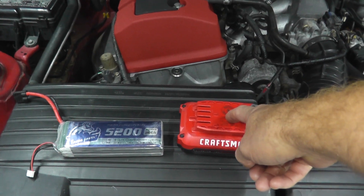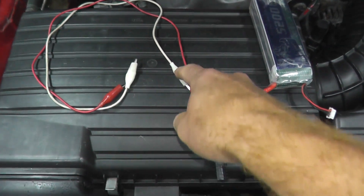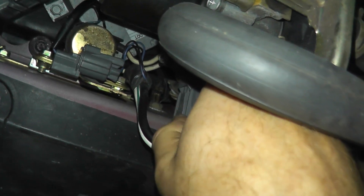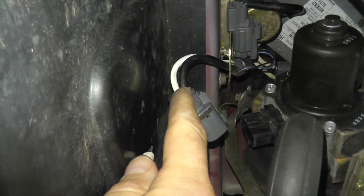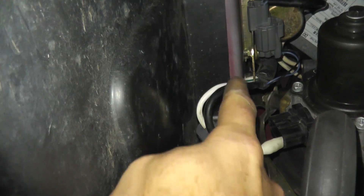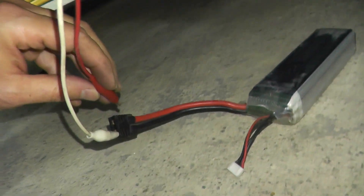You can use a cordless battery pack. In my case I have an RC battery pack that pushes out 11 volts, and then I have two wires with alligator ends. This will allow us to send power from the pack to the pump. We need to find the electrical connector — there's a harness connector and at roughly the 9 o'clock position there's a tab. Press down on the tab and pull on the body. The black wire is our ground wire. I'm inserting the negative lead from the battery onto the terminal corresponding with the black wire, and the red wire goes directly to the positive lead on the battery. If the pump is good it should spin.